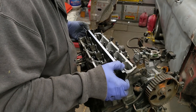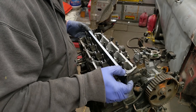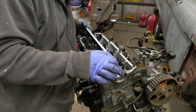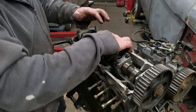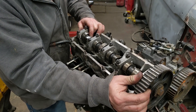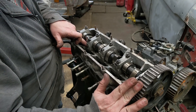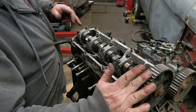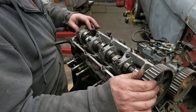After heating three times total, with no tension on it, this thing is laser straight. You couldn't machine it straighter than that. I put the cam in — these aren't torqued very tight, just to check — and I can see there's no resistance on the cam at all. We are good.